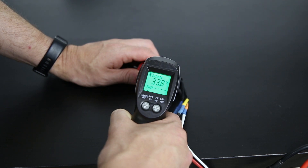Now that we've seen both examples and know the first isn't necessarily common in the RC industry, is it a reason for concern? It could be, but we don't know based on a no-load test alone. The intended purpose of that motor is to be installed in the RC vehicle and used under load. These power systems aren't designed for zero-load operation, and frankly there's no point in it. What matters is the temperatures we're getting when everything is installed and we're running the vehicle in its typical environment and configuration — that's what we want to base all thermal data on.